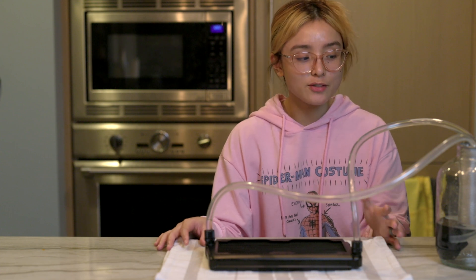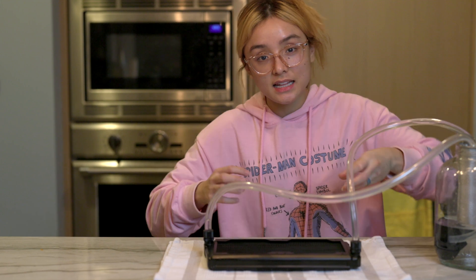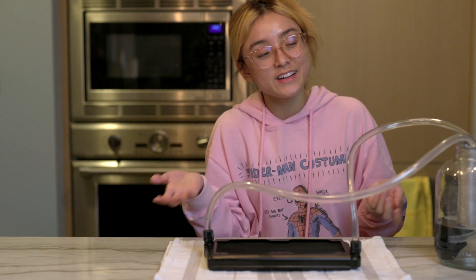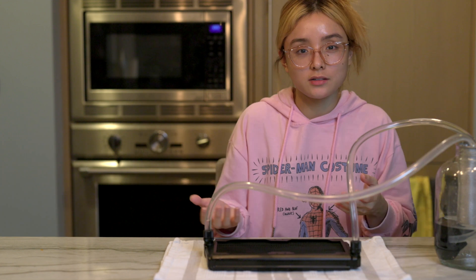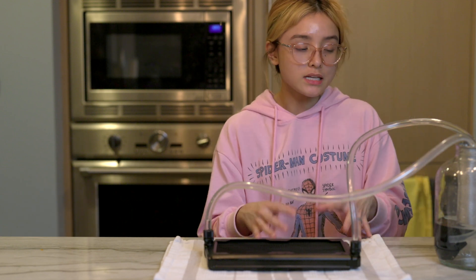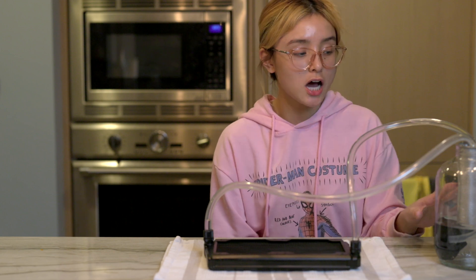It's been running for a couple of hours now, so I think it's pretty much done. The reason I love flushing out my radiator like this is because I've tried the other approach where you pour water in, rotate it, shake it, and pour it out — again and again. You can't just do that once or twice; you have to do it like 10, 20, or even 40 times. It's a lot more work and sometimes there's still gunk left. With this loop method, you just leave it on its own, let it work its magic, and the gunk appears in the coffee filter. Let's see how much gunk we got.